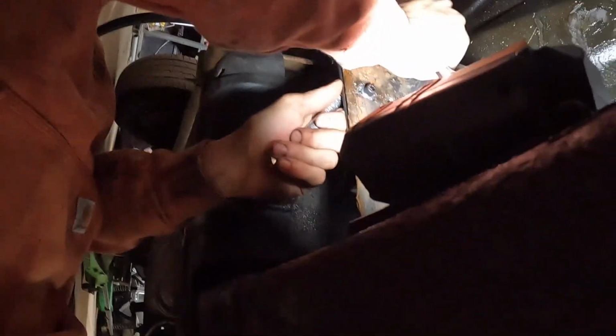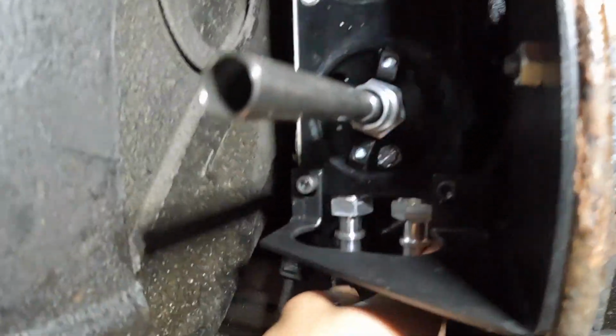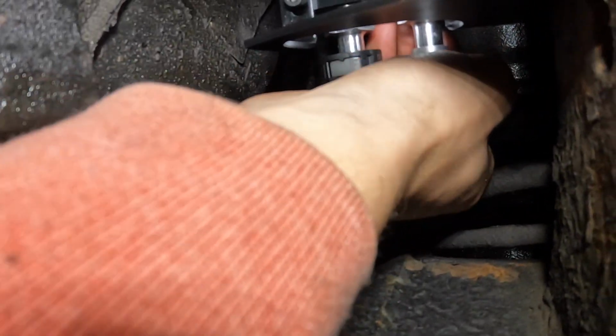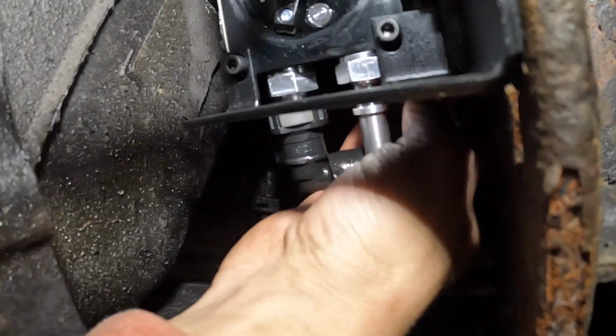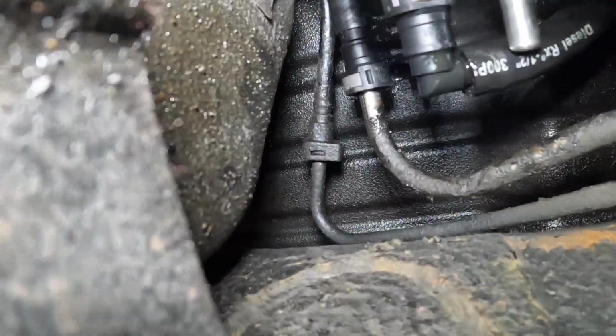Oh yeah, and then we got the line ran on top of the tank. So the next thing is we're gonna run the line, well, one of the lines to the lift pump here, and then the other stuff. All right, so we got the line right there that goes back to the tank, and then right now Klom's routing the one that went to our hard line in the back, and you're gonna connect that to the one closest to the tank right there and hear a click. There we go. So that one you kinda just gotta loop around because the line you need to connect to is right above you, right up in there. So you just loop and then go into there.